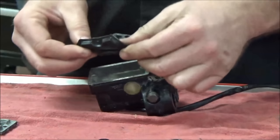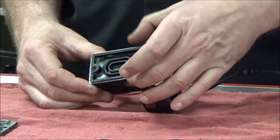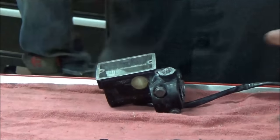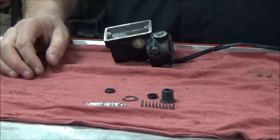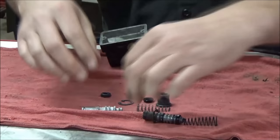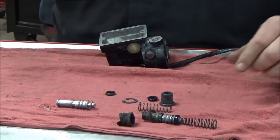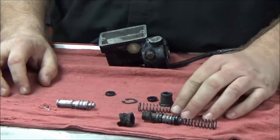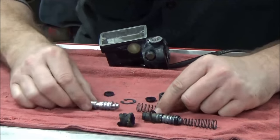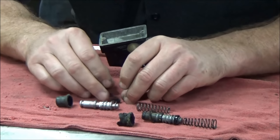The diaphragm needs to have no tears, it should be flexible and pliable, and it should fit in here nicely. If it's really swollen it's going to have a hard time sealing. Don't get brake fluid on any painted surfaces. Now for assembly - I'm going to lay out the pieces I took apart and model putting this back together. I checked the service manual and microfiche to confirm they're in the right order. I have my rubber cup and a couple of seals.